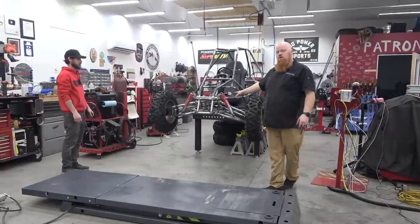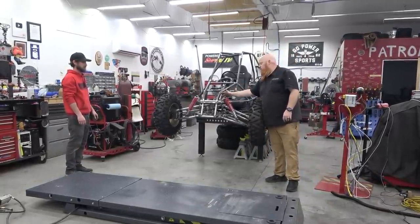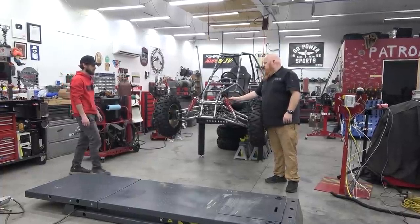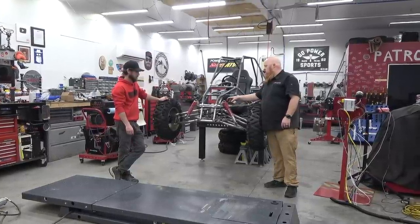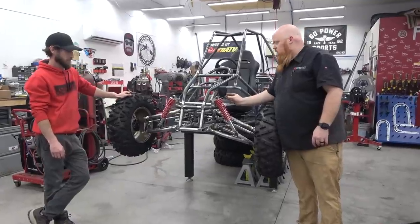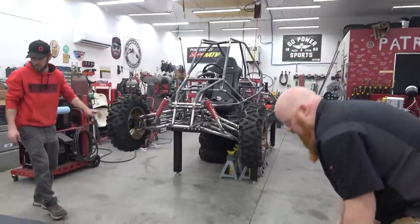These shocks I do not think are going to work in this position, and these are very weak shock mounts — these are not going to stay like this. We're just going to box them and brace them off of this. I don't like them at all because I had to trim them so much. I think we're going to have to stand this shock up more to get enough tension out of it to make it stiff enough. If we do that, I can cut these off and recreate a shock mount that uses both tubes so the impact is going into two tubes. Right now, these would rip off in a hard off-road.